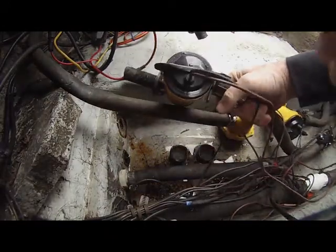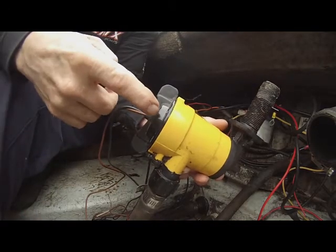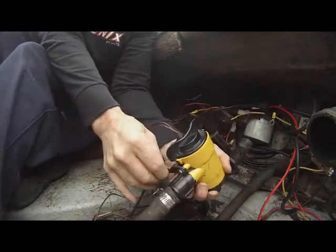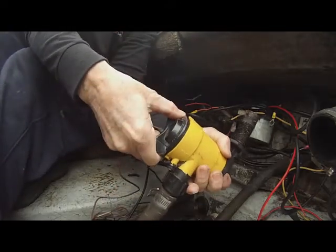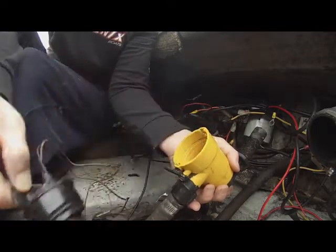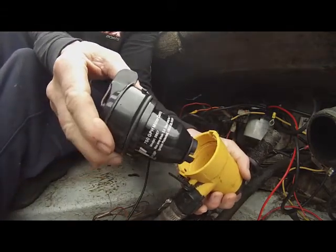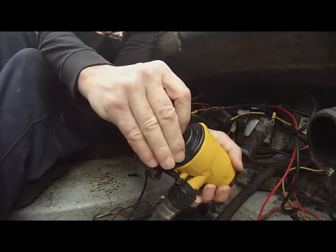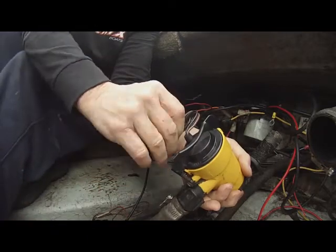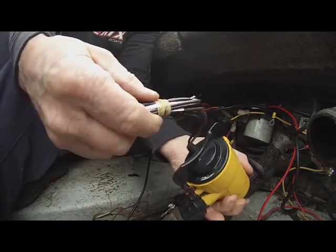There's my pump — here's the cartridge. To pull it out, there's a lever here that you pull out of the way, then you just twist the top and there's your motor. Pretty amazing. Now you just set this aside, and I have a replacement motor — all I have to do is pop it right in, twist it, and there's my new motor. That's all I have to do. I will have to splice it in and connect it to the wiring where the other one was connected.